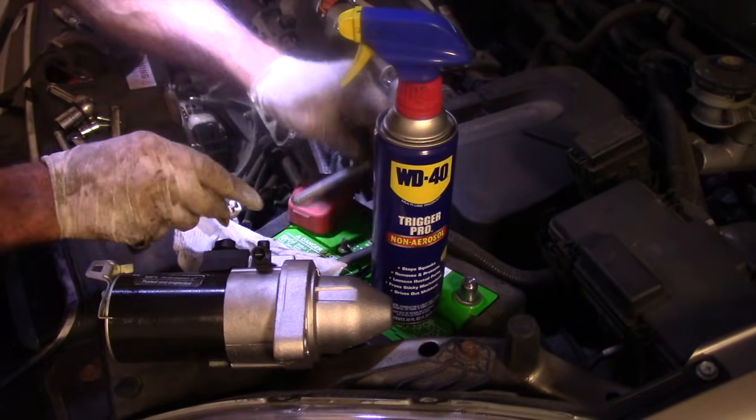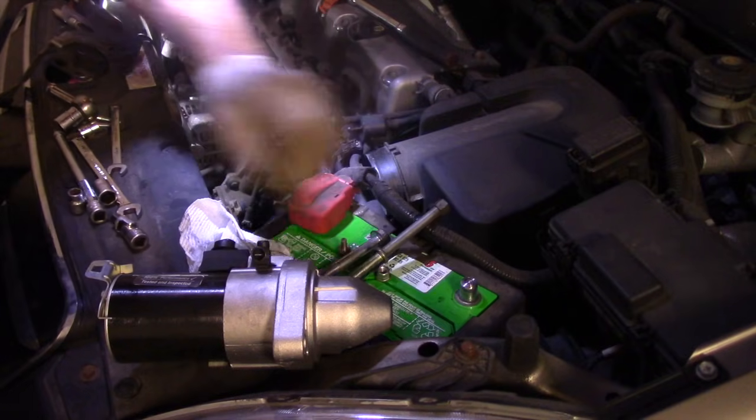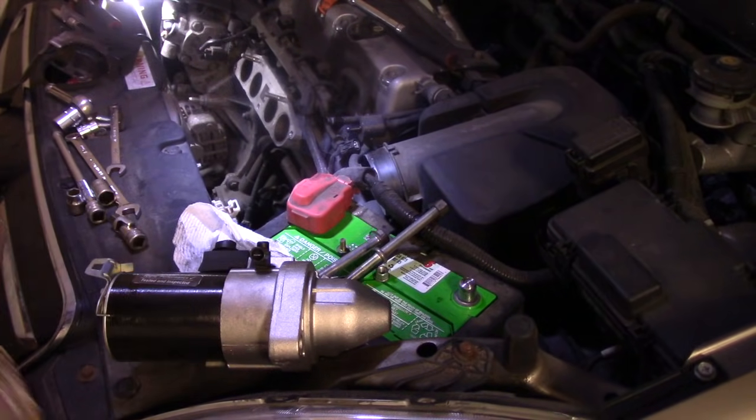We're going to spray up our bolts with some WD-40 so we don't have this problem in the future. You can use WD-40, you can use Never-Seize — whatever works for you. Now I want to point this out: when the intake manifold was a little bit stuck coming out, if it's stuck and you're pulling it out, don't force it because you may wind up snapping off an ear on there. If you snap off one of those little plastic ears, you're going to be changing the manifold. That's why when I was pulling it out, I had to go down in there and unplug the wire on the EGR and also the vacuum line. So don't ever force it — always look to see what's holding it in there.